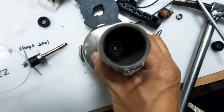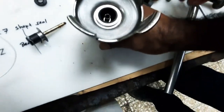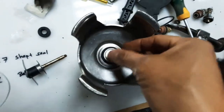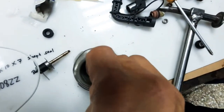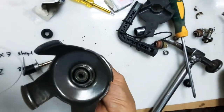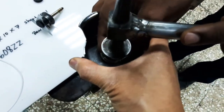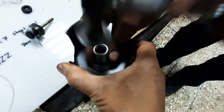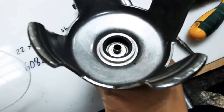Insert inside, then place the spacer, then put the other bearing. Using this chisel, I place this here so that it will not push back, and I am inserting or pushing the bearing inside. Using a 16mm socket, we push the bearing inside. The bearing and the sleeves are now sitting properly.